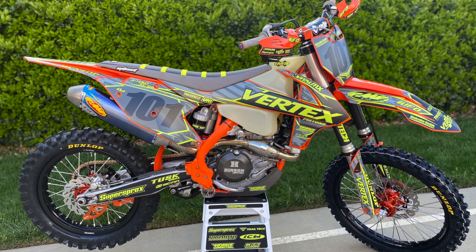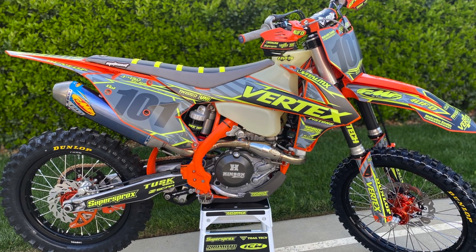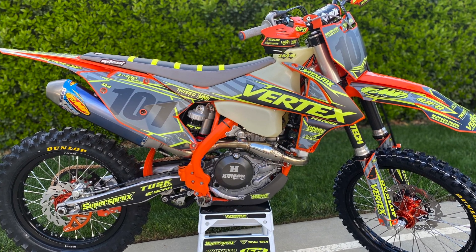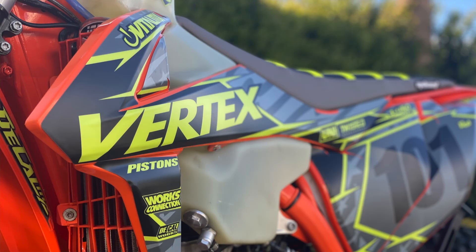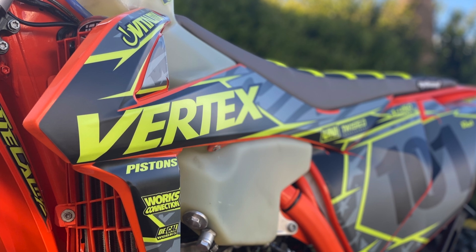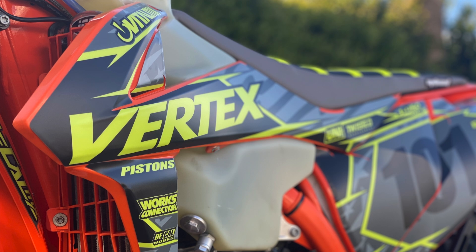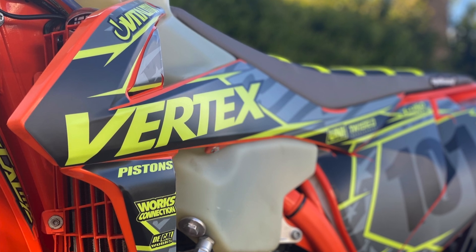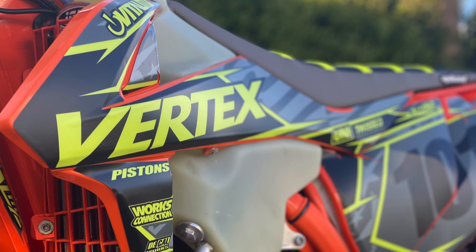And you go, well, how can you do that? Because they're totally different — they got different transmissions and all that. No, they don't. That's the big terrible truth about KTM SX and XCFs: they have the same transmission on these bikes, on the 450 and the 250. The 350 is the only one that, for some silly reason, has different tranny ratios and an extra six gear — different ratios from SX to XCF.